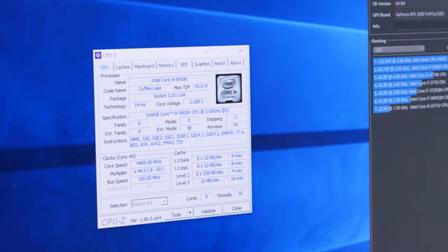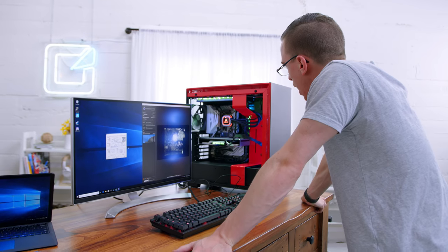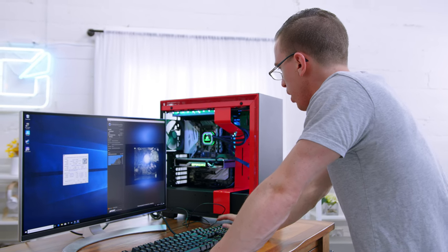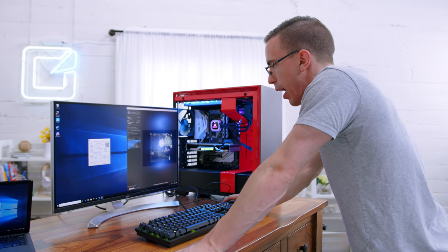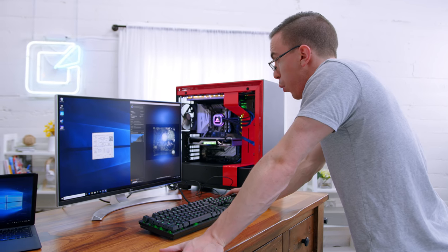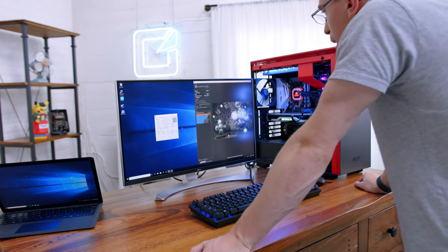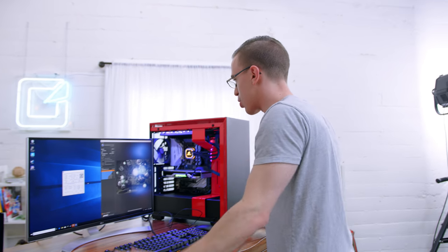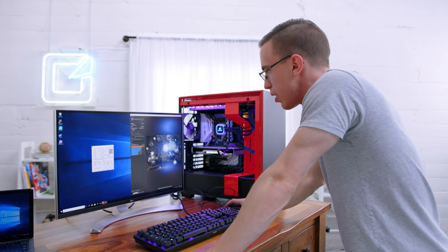While we're running the test, it's looking like around 4.4 to 4.5 gigahertz. Actually, I don't know why this is not boosting higher. I mean, it's a perfect single-threaded workload. It should be at 5 gigahertz or at least somewhere around that. But we're pretty much topped out at 4.4 to 4.5. I wonder if the technical problems are already beginning. 190, man, that's lower. So we got like 210 or so on the 8086, and that's 100% because this is not boosting up higher.